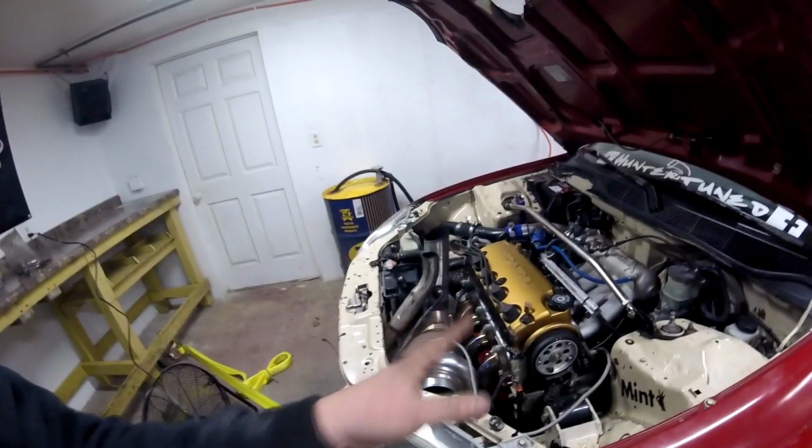It's not a bearing issue and it's not a clearance issue. I'm just wondering if there's somewhere in the head where a port is not plugged off. I know D15Bs have a restrictor in the block so it doesn't send too much oil to the cylinder head. I know this doesn't have that, but maybe it needs it. I don't know. Because after it's hot, the oil pressure gets down to like 5 or 10.